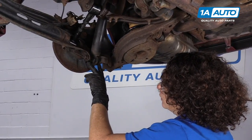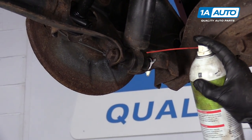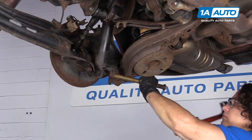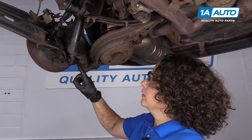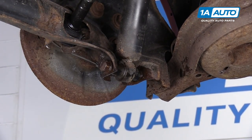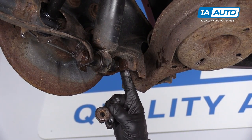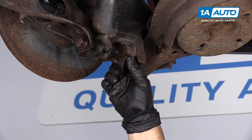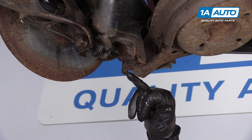The brass punch and hammer are loosening up the rust, but it's still not coming out as fast as I want. So I'm going to help it along with a little rust penetrant. I'm going to let that soak for about five minutes and then start hammering away. I sprayed it down, let it soak, and I've been hammering back and forth with the biggest hammer I have. Now it's time to get the air chisel out with the flat head on it — that's a steel chisel, so you have to be careful with the bolt because I need to reuse it. Old trick of the trade: I'm going to start the nut back on flush with the bolt. That way, while I'm hitting on the tip of the bolt, if I slip, I won't ruin the threads.